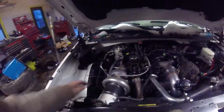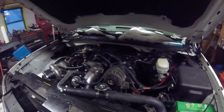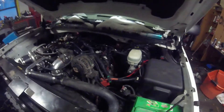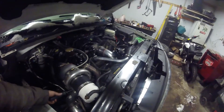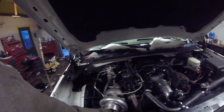I made this tester here. I had a few minor leaks — a couple of these little vacuum connectors were leaking. It wouldn't even build two pounds of boost with the tester, and I'm running seven to ten pounds depending on the day. It's always a great idea to boost leak test on a turbo car. You can definitely overlook a lot of boost leaks that you think wouldn't make a difference, but they could be worth anywhere from ten to a hundred horsepower, depending on the severity of the leak.